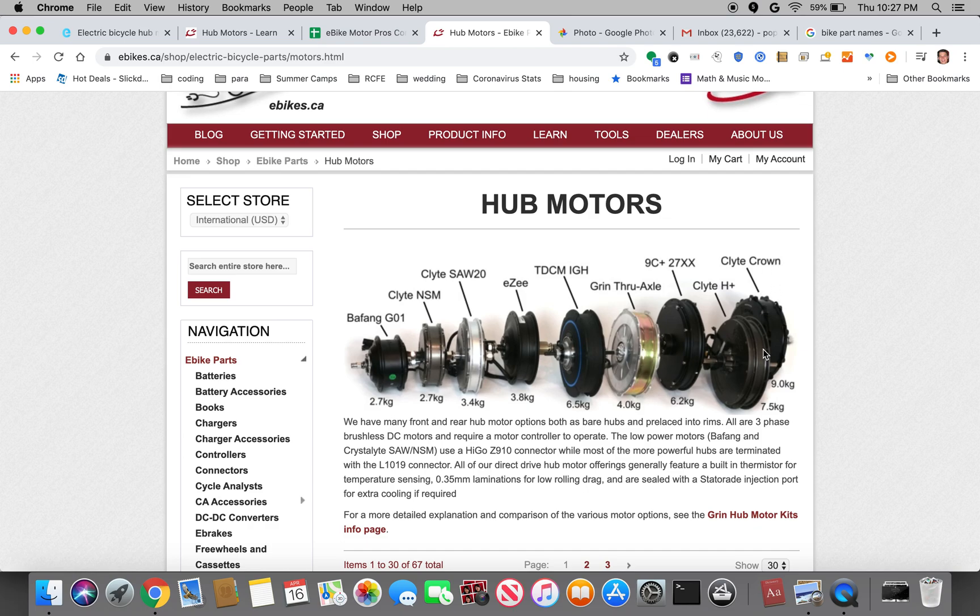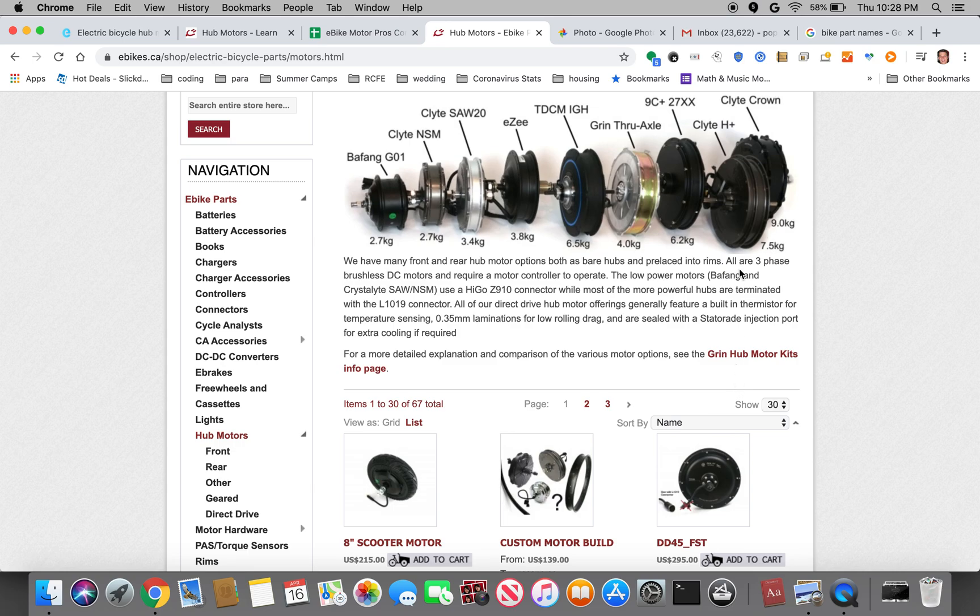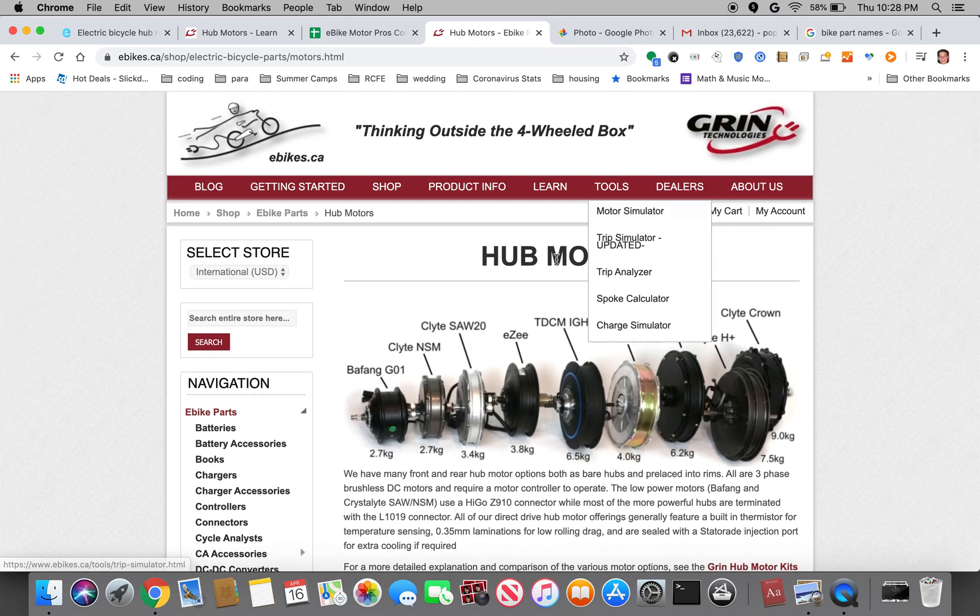I think the Crystallite crown motor is one of the most powerful motors you could get — with this one you could build something like a 2,000 to 3,000 watt system. I should also mention that the Crystallite was more efficient, so it had a longer range than the RH212. I think one big reason is it's just a bigger motor — because it's one kilogram bigger, it also has a bigger diameter — and it has higher efficiency at low speeds, which is something I liked. So that summarizes the different hub motors I looked at, and in the next video I'm going to go through how to use the motor simulator to compare different motors.